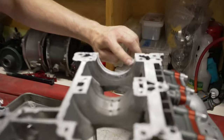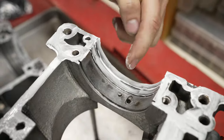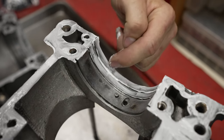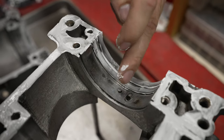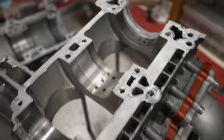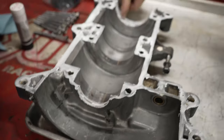Get a little bit in these grooves where the seal's going to ride. You don't want to get it on the bearing surface — this groove and land is for the seal, but this one over here with the dowel pin, that's where the bearing is. Just make sure that seal is good, same with the front and on both sides of the case. Clean up your edges with a Q-tip.